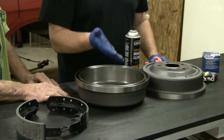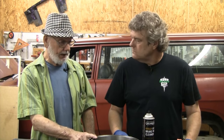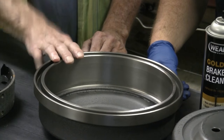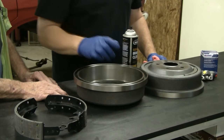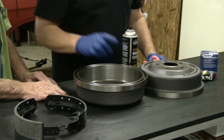Otherwise you're going to have problems with the shoes or pads not operating at optimum. Also, if you've got grease or an oily substance in there, it could cause the brake to grab — meaning during a panic stop, that wheel will lock. What I like to do is go in and put a cast coat on the outside of the drum. You can get high temp cast coat now, and that will keep the drums from rusting on the outside. So that's our first tip: keep it clean, and that pretty much goes for anything you're doing.